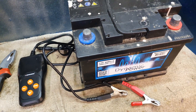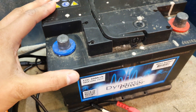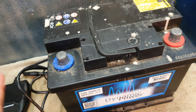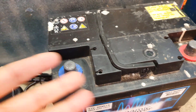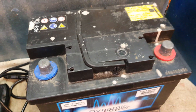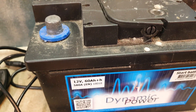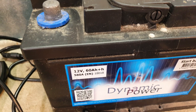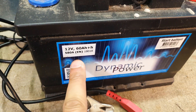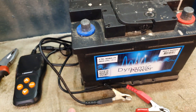I wanted to introduce it to you guys because it's so little and weighs almost nothing. I'll put a purchase link below the video. Now, the indicator shows green so the battery must be in good order — this is an old battery I have in my garage that I use when testing 12-volt devices. It's a 12-volt battery, 60 amp hours, and 580 amperes EN — that's the European standard. Note that EN is different from CCA, cold cranking amps, so you have to check what the letters after the amperage are.